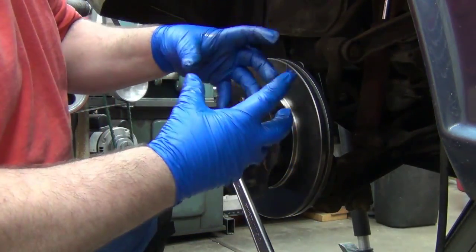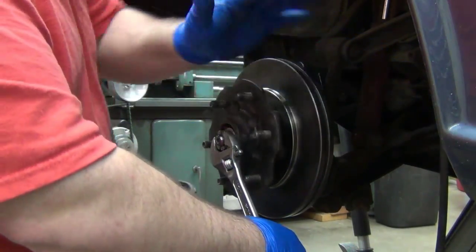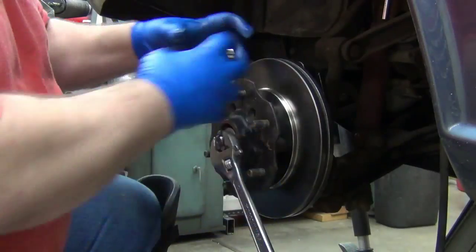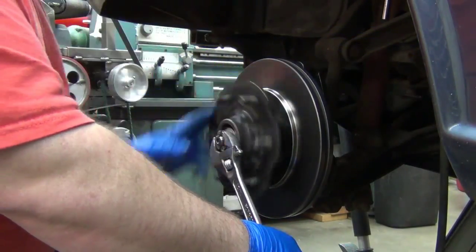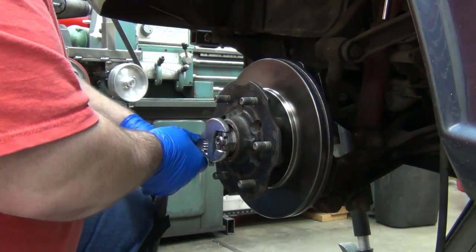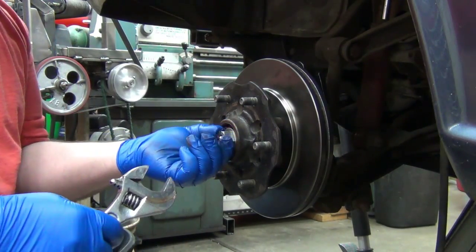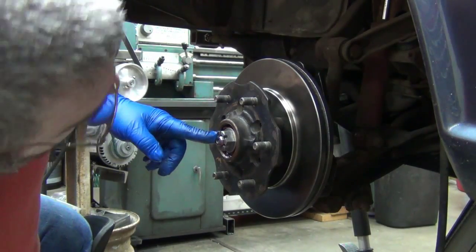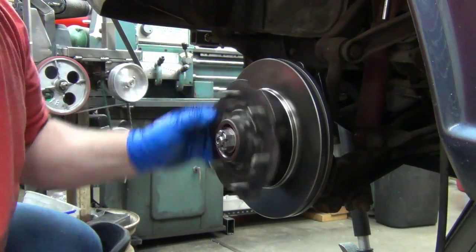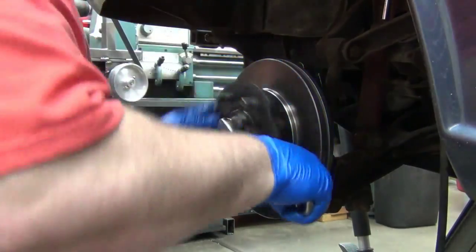And what that's doing is squeezing all those roller bearings and races and grease and that stuff and getting it to seat down good and tight, to make sure you don't have one in there slightly cattywampus and you tighten against that once and call it good and then everything's really sloppy loose. So I tend to rotate them both directions. I get it nice and firm. Now let's back it off until it becomes finger loose. Now I finger tightened it up and I'm past that hole, but I'm on this one. Now just for feel, to get to the next hole, that's tighter than I want it. I don't like how tight that is. Okay, so I'm going to redo it again.